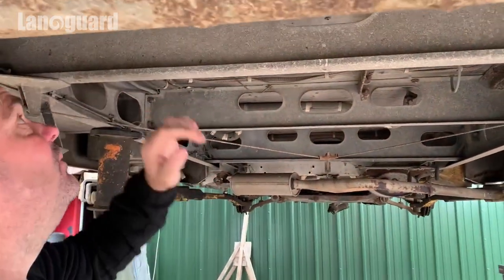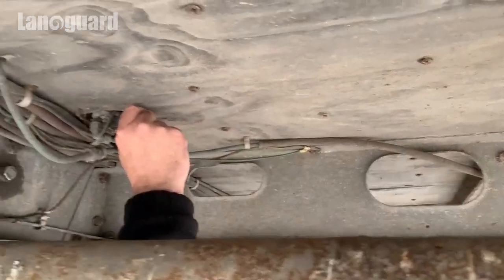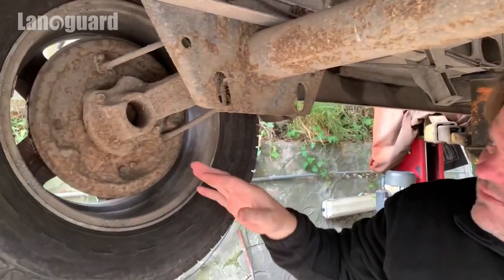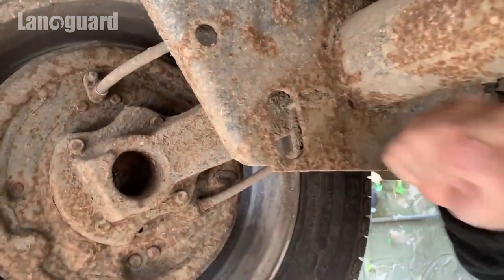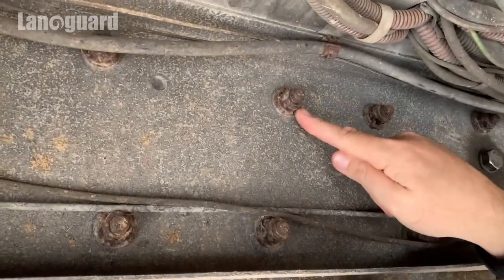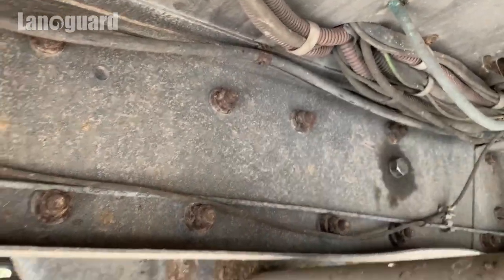Obviously this is galvanised, but when you've got galvanised parts, there are sacrificial anodes at play. So this is very rusty. It's all the little small running parts on the motor homes generally that are a problem. Now this is probably not going to break, but why not protect that? And you can see the bolts are going, and that's again because they're through a galvanised piece, so they're giving a sacrificial corrosion.